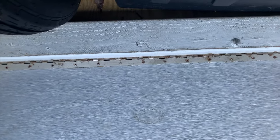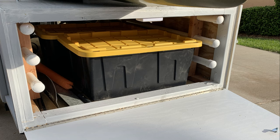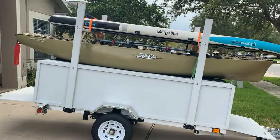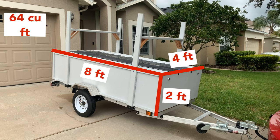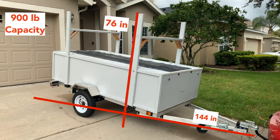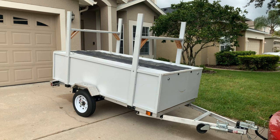The front gate and the rear gate are mounted on piano hinges so they open up all the way. This allows for full access to the whole trailer without having to reach in too far, and works really well for loading large items like tents and canopies. The kayak towers are made from two-by-fours that are lag screwed to the frame of the trailer — very secure. The size of the box is eight feet long by four feet wide and two feet tall, which gives 64 cubic feet of cargo carrying capacity, about the same as a small SUV with the seats folded down. The overall height is 76 inches and the length is 144 inches. The outside width is just over five feet, so it has the same footprint as a standard golf cart, and it fits fairly easily in a single spot of a two-car garage.